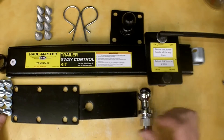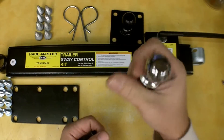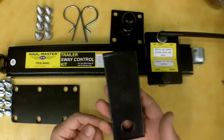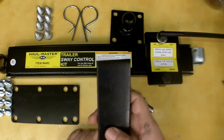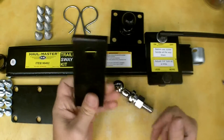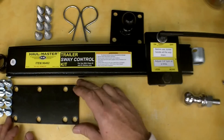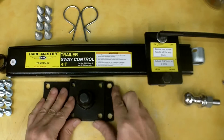Now there's one component in here I will not be using, which is this plate right here. If you have a weight distributing hitch, there's usually a hole where this ball will just mount into it. Since I just installed one in another video — if anybody's interested in that, you can check it out — I won't be needing this plate. But if you do not have one of those, this plate is so it can be welded to your actual receiver in your truck. You'll need to take it to a welder and it needs to be put on in a certain dimension from the actual ball of the trailer. It's in the manual. So if anybody does not have one that will take the ball, beware that you will need to have some welding done. As well, if there is a problem mounting this plate and the ball to the trailer rail, you may need to have this welded as well.